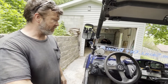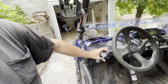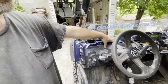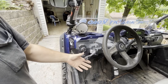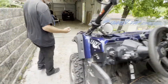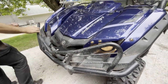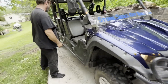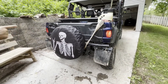I couldn't find a blinker kit that I liked, so I had to make my own. I purchased a unit designed for golf carts and put blinker indicators on the front using three-quarter LEDs. I added a blinker relay that makes an audible sound so you remember to shut the blinker off, because there's no auto-cancel in the steering. For the rear, I wired the tail lights to work with the blinkers.